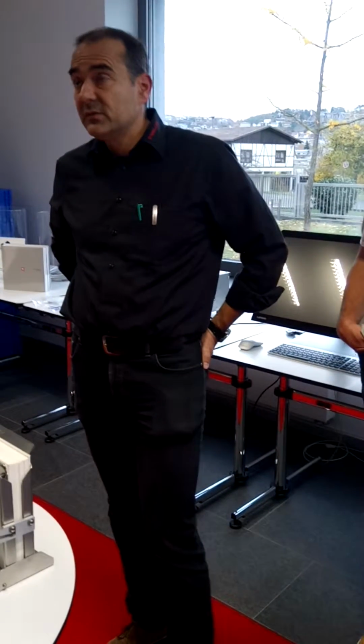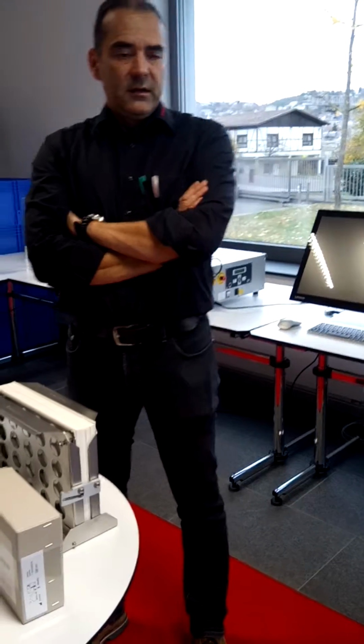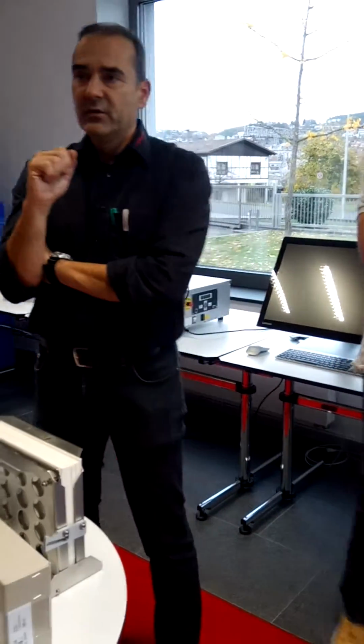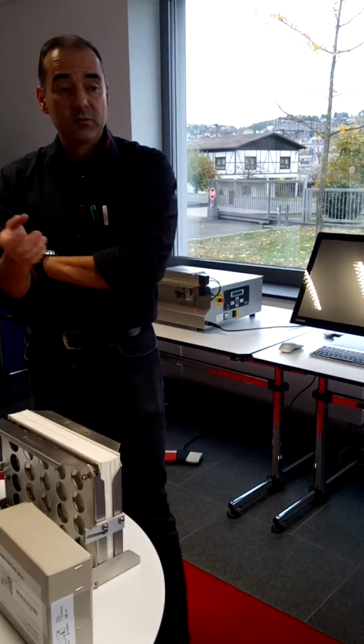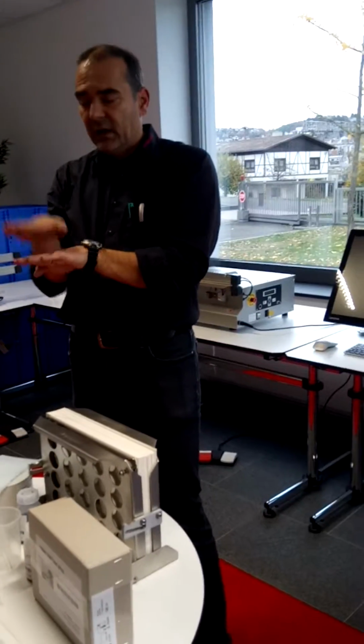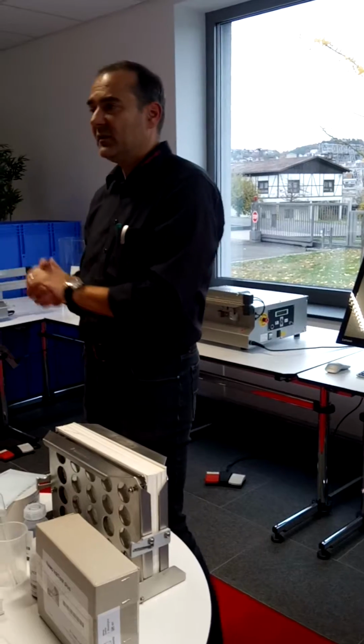We say, yeah, 30,000, and how many do you do per day? Yeah, our customers do 1,000 pouches per day. Yeah. So every month a new belt or new complaint. And then my colleague Dominic arranged with our design engineer that we have to do some trials with larger versions or different angles, and we have now a solution that he tested on his development machine for 500,000 cycles. So this is the more durable or the heavy duty version now, where the tolerances, belts to tooth wheels, the angles, tooth belt strength, everything has been optimized to run consistently and reliably.